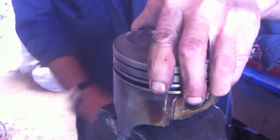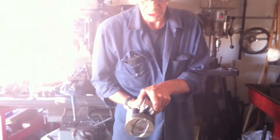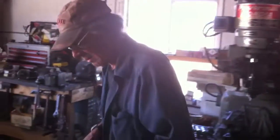Do you have the equipment to actually take them out if you wanted to? Yep. I press right there. Like a Chevy tool. Oh, we never say Chevy on Mustang Medic. It's basically a block of aluminum that's machined, because when you press these out, you have to have something that fits over the piston. When you put them back in, you have to heat the rod and push the piston pin in. But you're all set here.